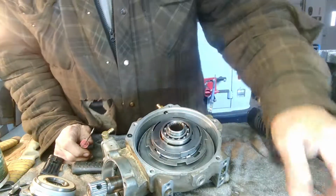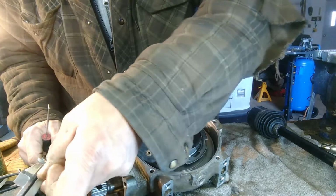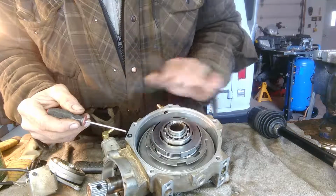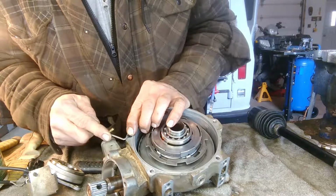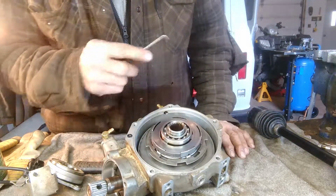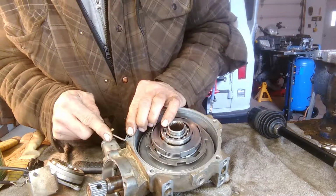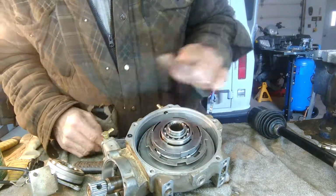Okay, I've had these O-rings. There's one here, and there's one on the other casing here. And I had this O-ring soaking in this AT205 for probably a week or so. And this O-ring used to fit in there, into that little opening. It would just fit in there, you know, kind of loose. And now it's actually bigger. So this AT205 is supposed to swell the O-rings. So that might be an interesting test for that, because it doesn't fit in there that good anymore. So when I put the case together, it should squish it together.